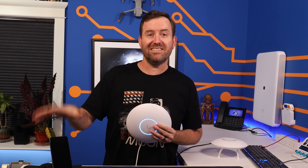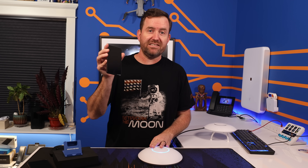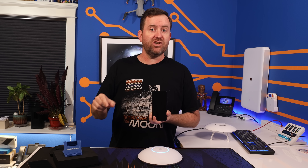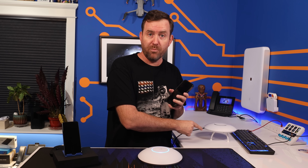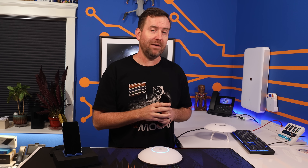This video is trying to review the performance of these access points, but it also showcases a pretty significant difference in the wireless capabilities of the older iPhone 13 versus the brand new Google Pixel 8. Also keep in mind that I'm only testing with a single device here. Many of the improvements that both Wi-Fi 6 and Wi-Fi 7 offer over previous generations have to do with increasing efficiency for higher density of devices. While I achieved similar results testing the U6 Pro and the U7 Pro with my 2x2 MIMO iPhone which is only Wi-Fi 6 capable, if you had 10 iPhones all testing at the same time, the 4x4 MIMO of the U6 Pro provides more lanes of bandwidth and may perform better than the U7 Pro that only has 2x2 MIMO in the 5 gigahertz.